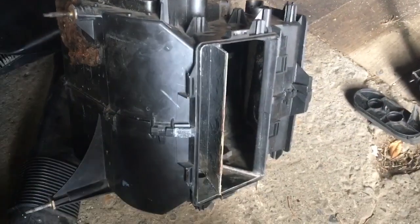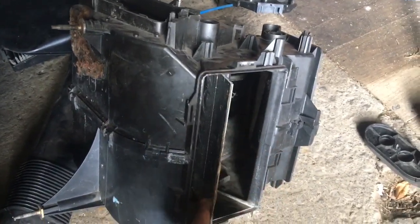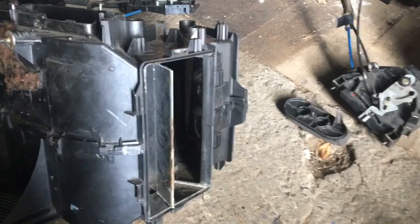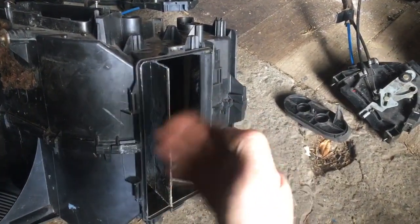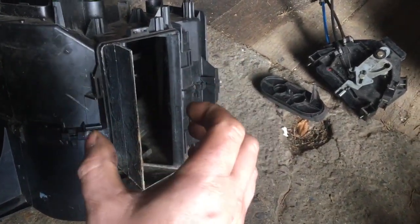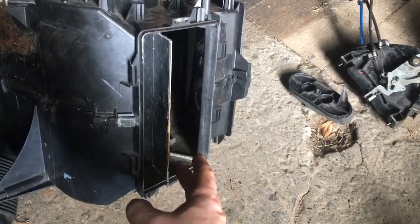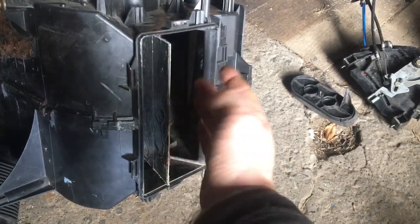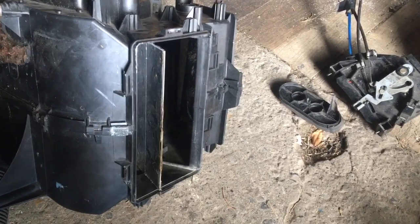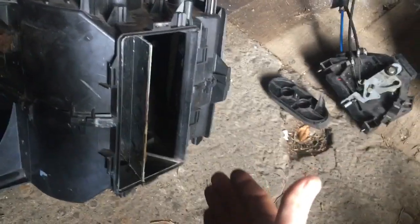I got this heater box secondhand. These are the little flaps that fit in it, and there are a lot of circles all down here. Talking to Charles the Humble Mechanic on YouTube, I asked what the deal with the circles was — apparently there's meant to be foam on them, and when you turn the flaps it lets a little bit of air through so you don't end up with a vacuum or incredibly high pressure. Even on a 15 to 30 year old car you start to see these little bits of foam breaking up — sometimes you'll see little bits of foam coming out of the vents when you turn on your HVAC or heating system, and that's what it is.